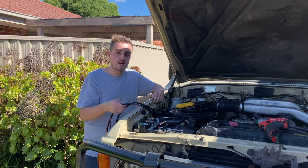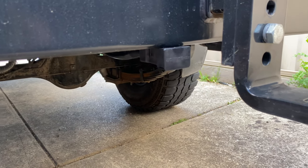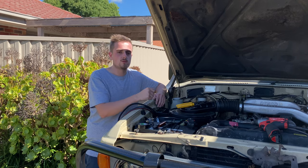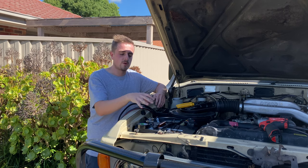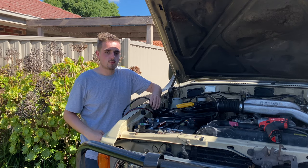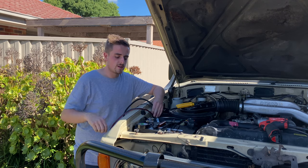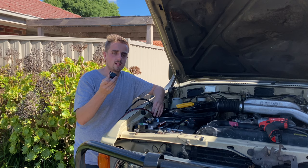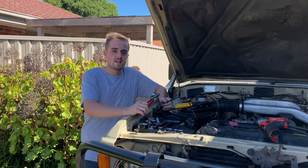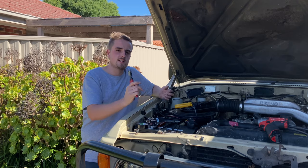Off camera here I've run 8 B&S twin all the way down the back. I've fitted a nice waterproof Anderson plug that flips down so you just flip it down and plug it in. That mounted up nice and easy - I did actually have one there originally but that was off the second battery, so I've replaced that. What I've got here is my earth and ignition feed for the relay, so that'll just be ignition when you're driving. Then I've got the 8 B&S twin here - the earth will go straight to the battery terminal and the positive is going to go through an 80 amp relay through a 40 amp bolt-in ACL fuse, and that'll keep everything protected. The next thing I'm going to do is hook up with this 4 mil twin - connect to pin 85 and 86, so that's ignition and earth.